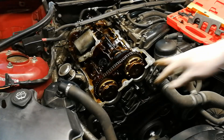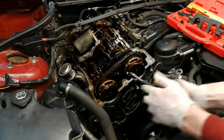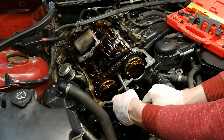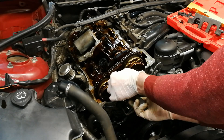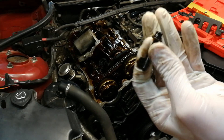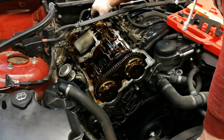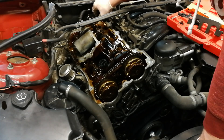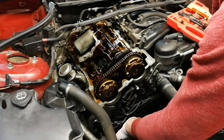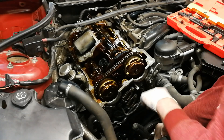This is an inverted E8 Torx and I'm just going to undo it. Now I can take out the screw. Next I'm going to take out the intake locking tool — I don't need it anymore — and I am going to release the tension on the chain by rotating it counterclockwise.